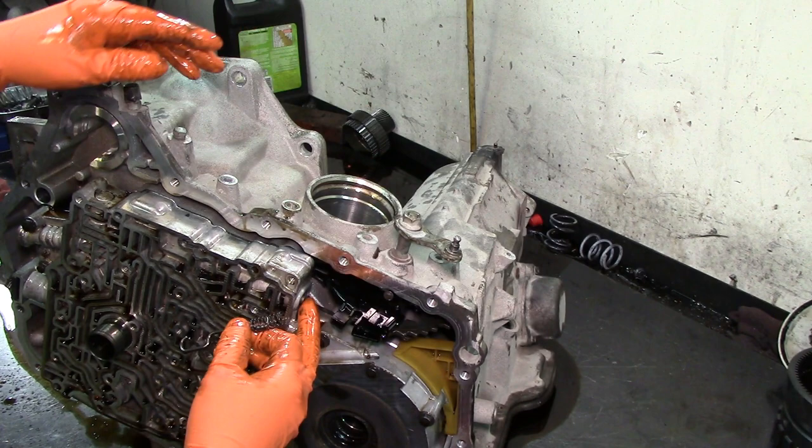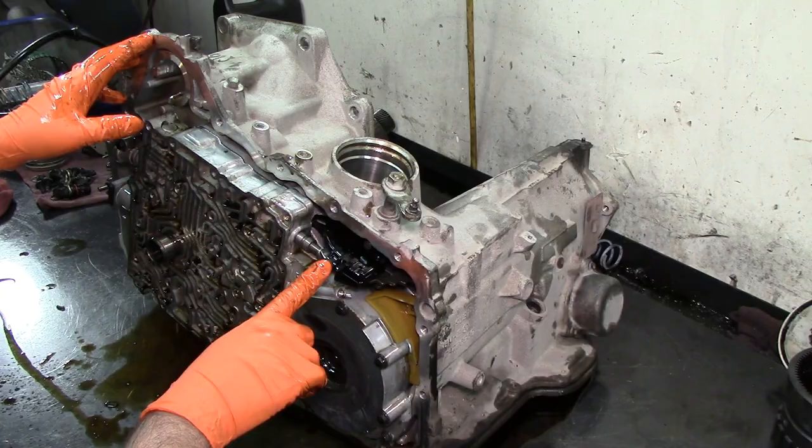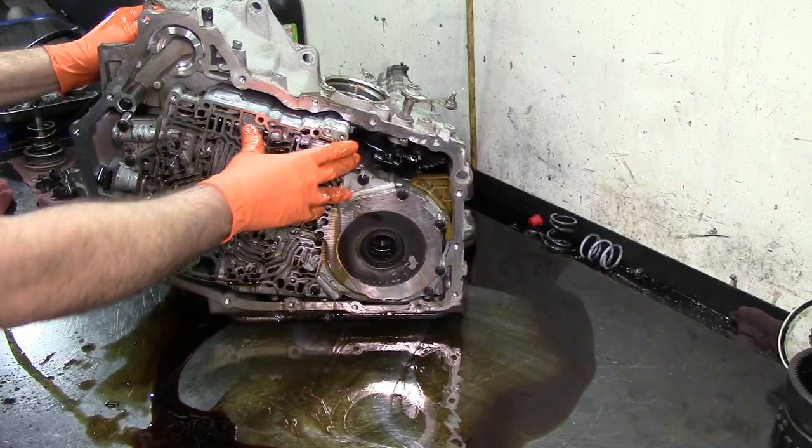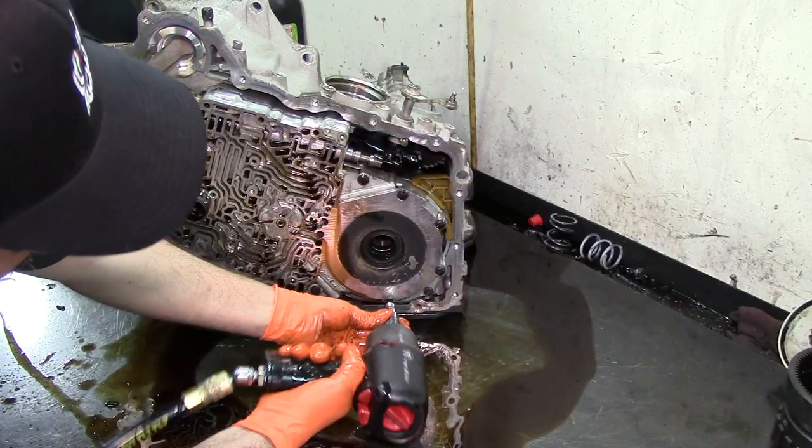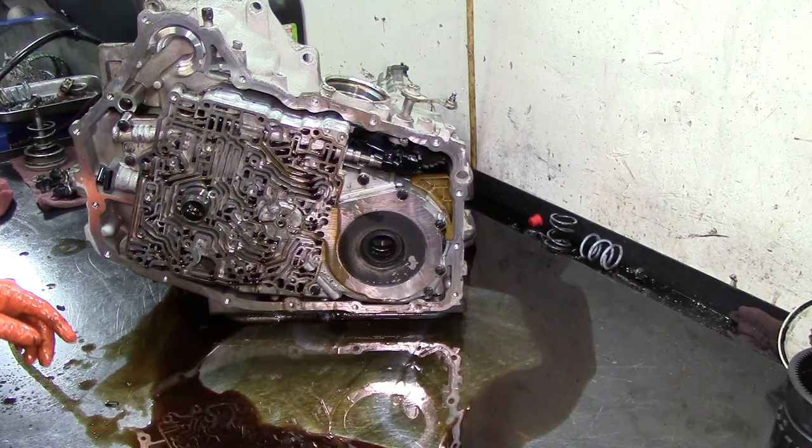All right, transmission range sensor. The manual valve wants to come out. Let's go ahead and remove our channel plate here. There is a Torx down here. Let's go ahead and take the Torx out first. Here, Torx 30, that out of the way.